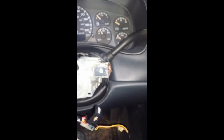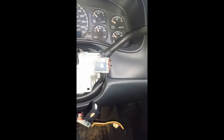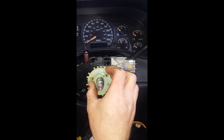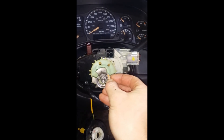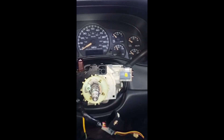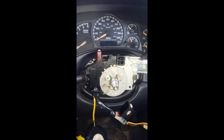I also took the lock cylinder back out because the guy's cylinder was worn. The old cylinder was worn into the old case, and when I put it in the new case it didn't want to turn, so we're replacing the cylinder as well. Once you've got your case back in, put your turn signal cancel cam back on — the pin goes in at about the 10:30 position. Your lock plate retainer goes in place — it only goes on one way — then your plate adapter and your special tool go back in place.